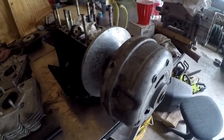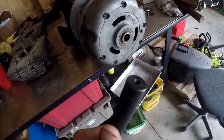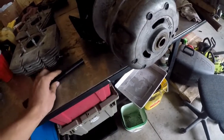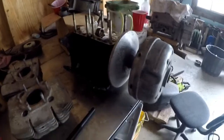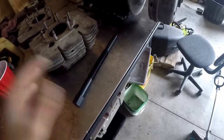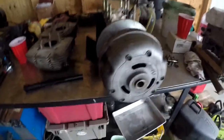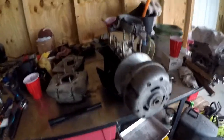I also bought this Polaris clutch puller - it kind of threads into the end of the clutch. I'm gonna try to get that on film for you guys, pulling the clutch off and see if it comes off. What I like to do is pack a bunch of grease on the end of the puller, then screw that in there with an impact and she comes off. Hopefully that's how it goes. I paid like 16 or 18 dollars for the clutch puller.